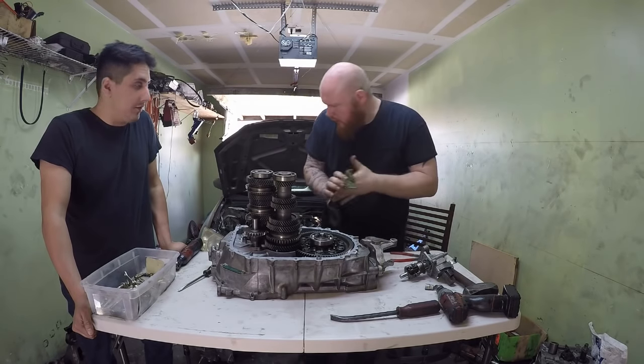Next step — got to glue on that shifter. Also, in order to do a six-speed conversion, you don't have to have the solenoid for the reverse lockout, but this piece right here is longer on a six-speed and that is required. So really, if you just change that piece, you could probably make it a six-speed without any trouble — at least for the shift assembly.